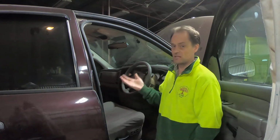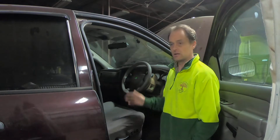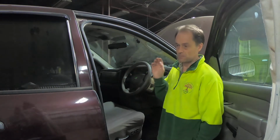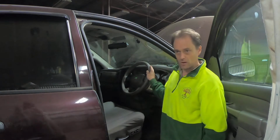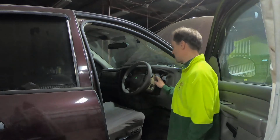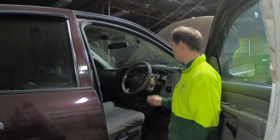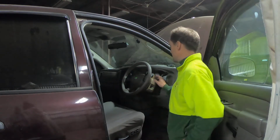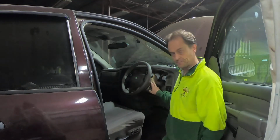The factory options from Autometer, not factory from Ram, would suit left-hand drive configuration, but wouldn't fit right-hand drive. What I came to find is they make a double gauge pod for the top of a steering wheel column, and that's what I went with. So I now have two gauges mounted on top of the steering column.